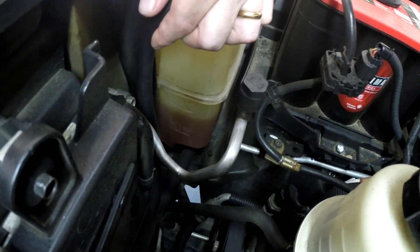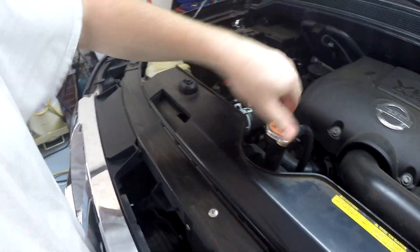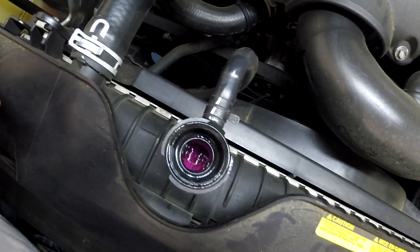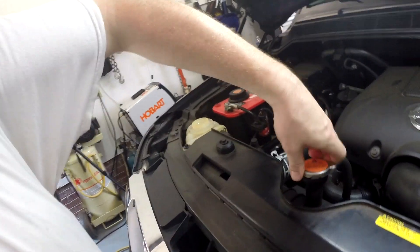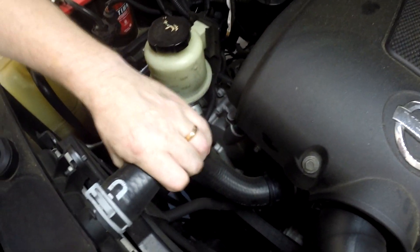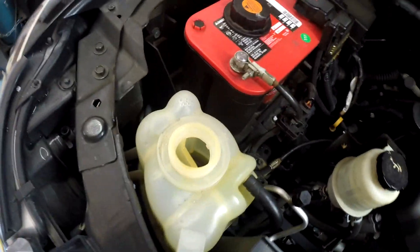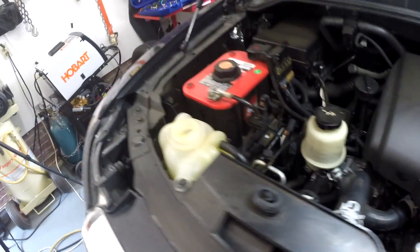The truck's finished filling. Let's get a look at the expansion tank — there are the min/max marks and it's right below max. I'll pop the radiator cap off to show you the radiator itself — it's red at the top, so it's full. All the hoses have come back to shape and you can squeeze them — no air bubbles or anything. So I'm going to start it, let it run for a few minutes, burp it, and that's it. That's the Astro 78585.